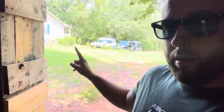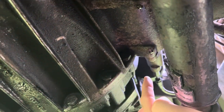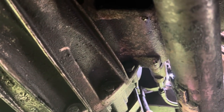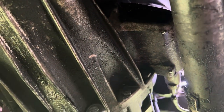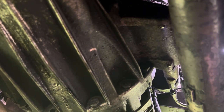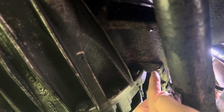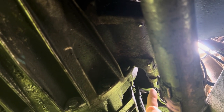So I got a new slave cylinder — we're gonna go put that in now. Here's our slave cylinder, you can see it's leaking. This is clutch fluid, which is actually DOT4 brake fluid. We're gonna break this line — sorry this is blurry, the sun is peeking through and it's super weird. So we can see this is our slave cylinder right here, this is where we're leaking — it's actually coming out through the back side.